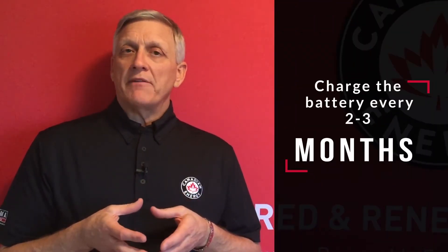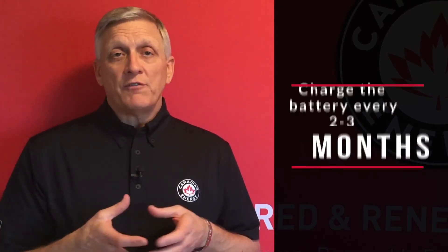We recommend that you charge the battery every two to three months. This might be more frequent if you're in a hot weather environment. In Canada, typically it's fairly cool and two to three months will be sufficient. Ideally, if we have a good charger maintainer — something that's going to simply monitor battery voltage and top the battery up when it needs charging — then we don't have to worry about connecting the charger every couple of months. We can connect a good maintainer, leave it connected 24/7 to the battery during the off season, and we'll be sure that the battery is 100% state of charge and 100% state of health during the winter.